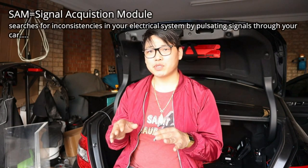In doing that, you may introduce an issue with either fuzzy lines or something they call noise, giving you an inconsistent display once you engage reverse. In order to overcome that, you need to use something like a rectifier, a capacitor, or a relay. We need to understand that Mercedes has a SAM module in their car, meaning it sends pulses through the car looking for any inconsistencies. If there are any inconsistencies, it will display an error message. To overcome this, use a rectifier, capacitor, or relay to stabilize the voltage when hooked up to your reverse light.